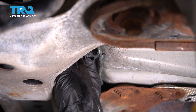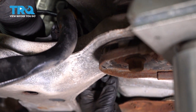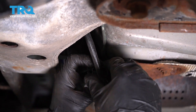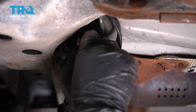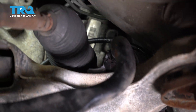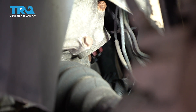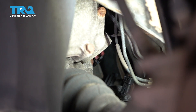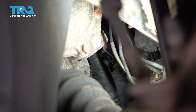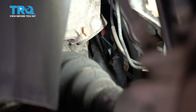Now we're going to run the harness back up through and over behind the power steering rack. I'm going to put this clip on and put it right through. I'll line these connectors up — all four-way dots right onto the female harness — squeeze it up as far as it will go, then push that plastic red tab over. Just like that. Perfect. It locked right in.